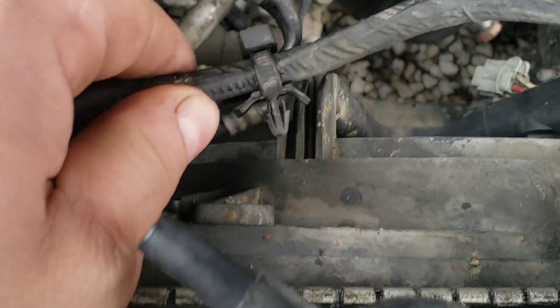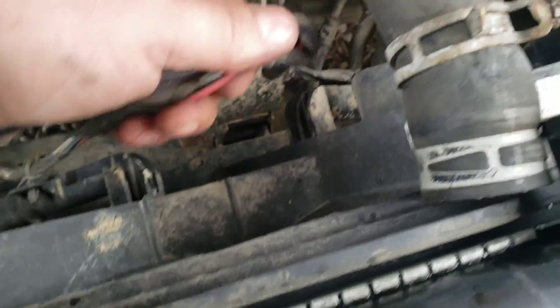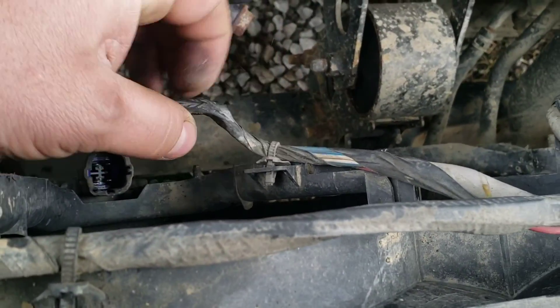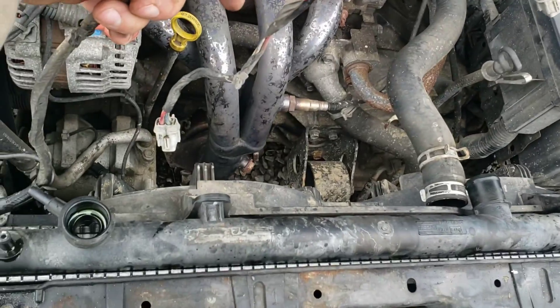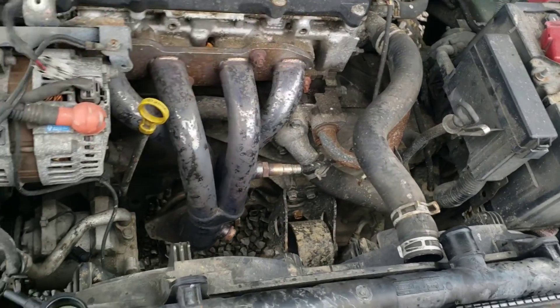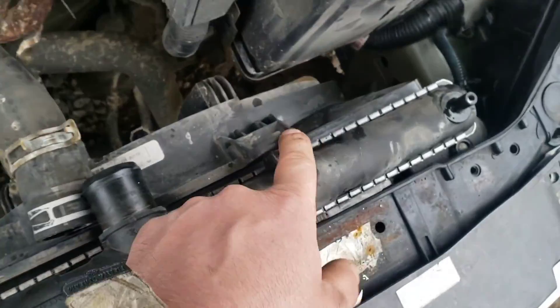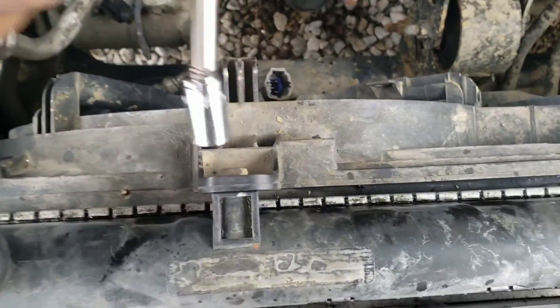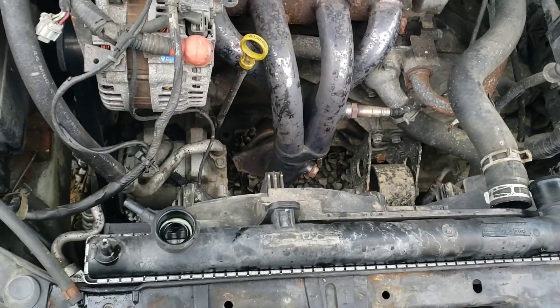So all the clips — that's what they look like. If you depress the edges in while it's plugged in, you might be able to pop it out without breaking them. I've got these last two out, so then this whole thing will just pull up. Just remember which wire goes to which fan — in this case it's pretty obvious, but not always. I believe it's just these two mounting bolts — those might be 10 mil again. Should be those two, and then it'll pull out.